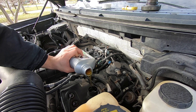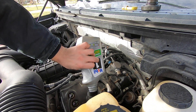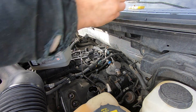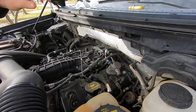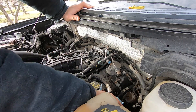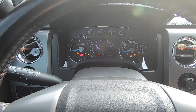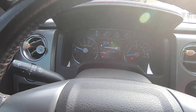I like to not use funnels — I'm pretty good with my hands just doing it this way. This engine takes six quarts. If you guys do spill it, you're going to want to clean up as much as you can because the turbos are right there and those run pretty hot — you don't want to start a fire. Let's start it up and watch that oil pressure gauge. There we go.